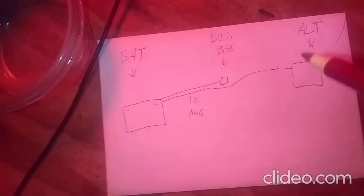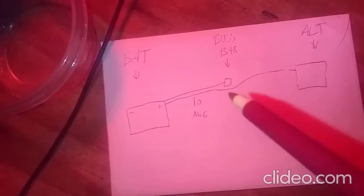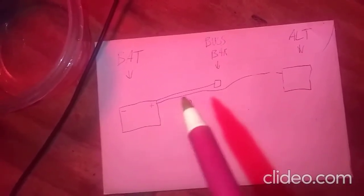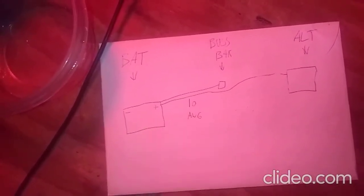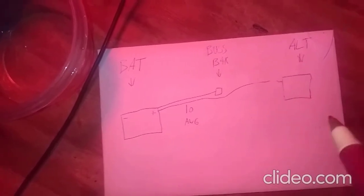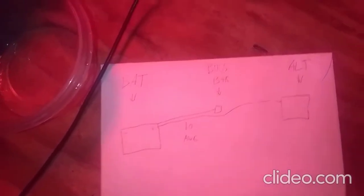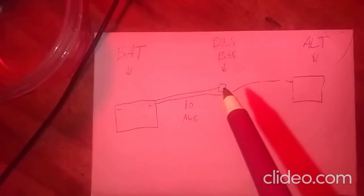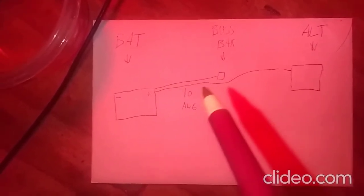It can just keep going, like this, between the alternator, bus bar to ground, alternator, bus bar to ground. And the battery at that point is just a buffer in the circuit. At that point you just have a little bit of current going back and forth during discharge and overcharge situations. The battery is just, like I said, a buffer. That way you're not making all the electricity go through the battery when it doesn't really have to. The other thing is, you've effectively made your charging wire way longer this way. Because, like I said, the electricity needs to eventually go here. So why would you make it go here? First, you've added this much length of wire that's just unnecessary.